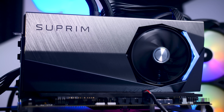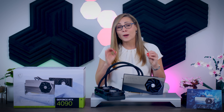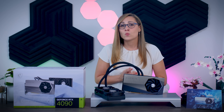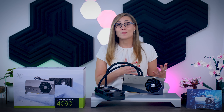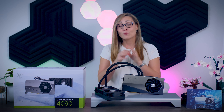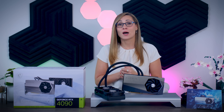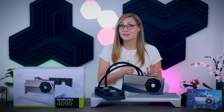If you have a good quality 850-watt power supply, you should be completely fine. But if you are buying a new power supply and thinking of getting a 4090, I would recommend getting a 1000-watt model. It will run closer to its peak efficiency — making it quieter — and you will have headroom for overclocking. More importantly, you will be ready for the next CPU upgrade, as they are rumored to pull even more power than their predecessors.